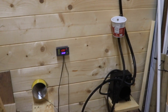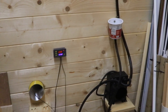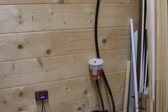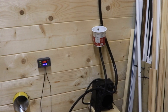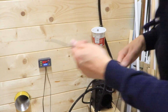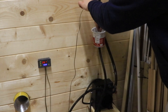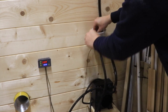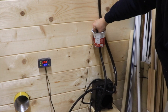Let's try and be a bit more scientific about this. At the moment we're measuring the heater outlet at 108 degrees — it's been running about 20 minutes. I've got a three metre thermocouple and I'm going to drop it into both sides of the heat exchanger to see what temperature the water comes out at. Starting with the inlet side, pushing the probe down as far as I can — it feels pretty consistent at 38.8 celsius.